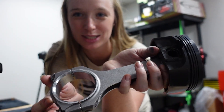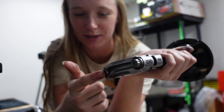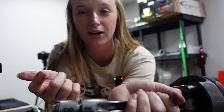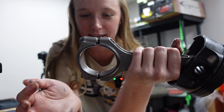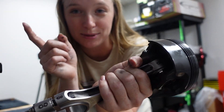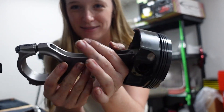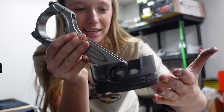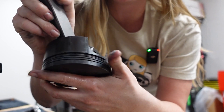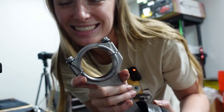For this process we needed to gap the rods — basically we're just undoing these bolts right here to loosen this up, and once we get the block in we'll be able to take these apart and fit the bearings in here. We'll wait for that probably at the end of this week, so stay tuned. I just did all eight and now we have these completely assembled — my hands are pretty oily but it worked great and this completely spins within it.